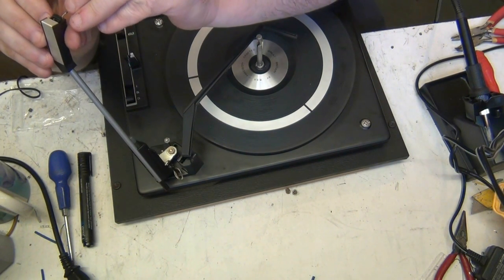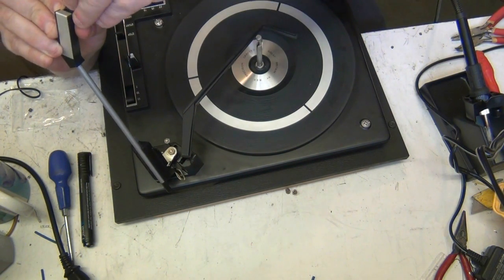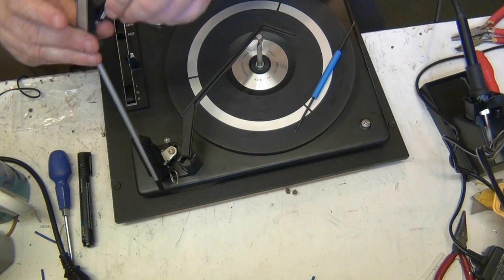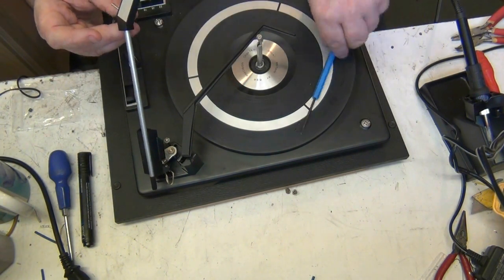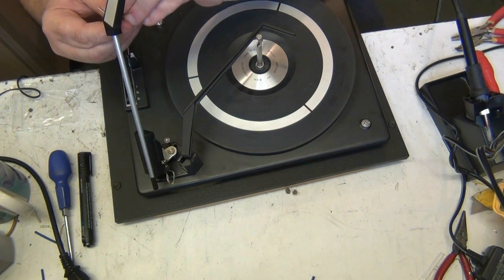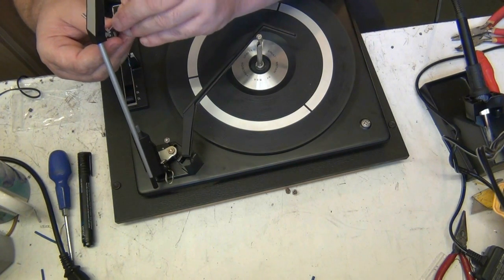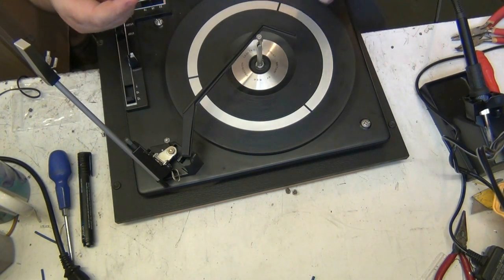But what I'll do, I'll take the cartridge out, because we're going to test it anyway. Come out, you. There we go. This is the original cartridge that was put in here, which I'm surprised, because they usually put BSR... what do you call it in these arms? SC12H. And I've actually got one somewhere, so if the cartridge is dead, we can chuck one of them in, and then she just has to get the stylus.